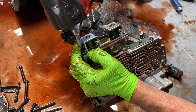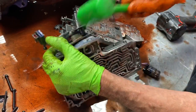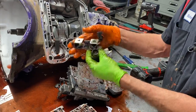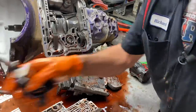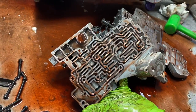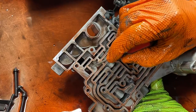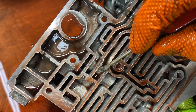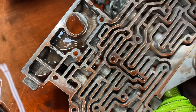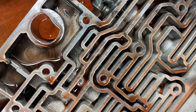We get our overdrive and lockup solenoid off here. When you buy this you get the new harness and the connector - you get this whole piece. They don't ever tie them in or anything, you just buy this whole block. Here are your lockup valves and your overdrive stuff. When you're cleaning this stuff just check everything, make sure it's free. But these little holes right here - see that little tiny hole - if you don't make sure that those two holes right there are clean, you're in trouble. You can make the valves work as good as you want, but if there's a microscopic piece of trash in those holes you're in trouble. So you make dang sure those are clean.